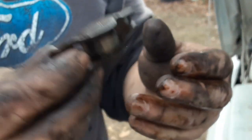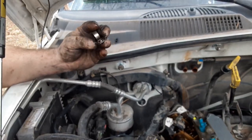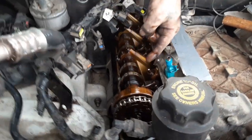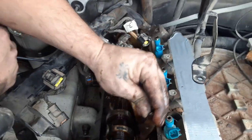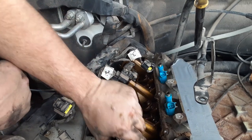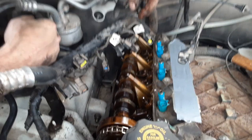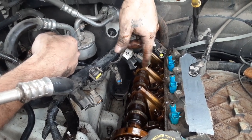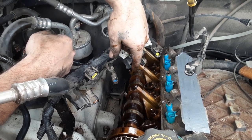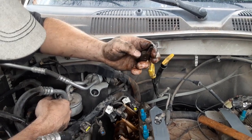Is that supposed to just be laying inside your engine? I don't think so. That explains why we're down a cylinder. Is there two missing? You see these? There's that one still there — that's the only one I see that was displaced. I don't even think it hurt the cam, so that's good news. Either way the head needs to come off still to make sure — and we have a water leak, it's spewing water somewhere. That's a roller lifter — I wonder how that came out of there.